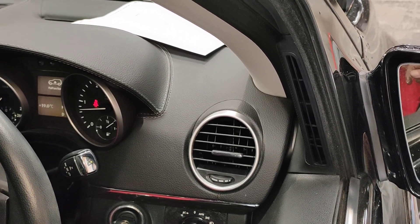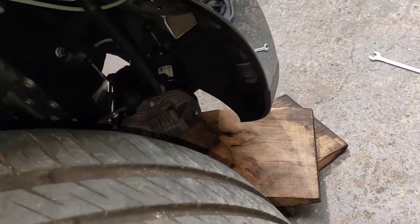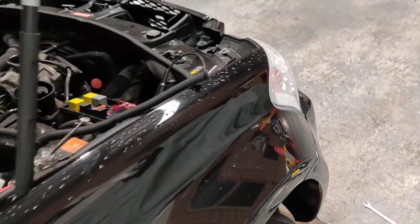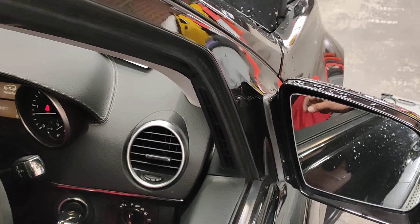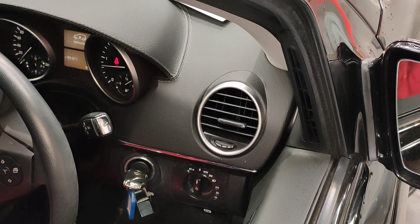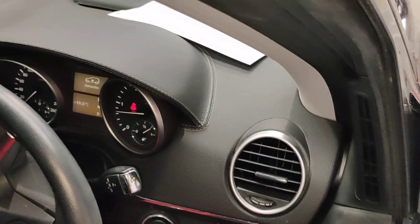The reason why the compressor was cutting out is because there's a short circuit with the actual pressure sensor, which is part of the air compressor. I've disconnected the pressure sensor side of the compressor, and now the car is running without cutting out. So I can confirm there is an internal short circuit with the compressor here, forcing the car to shut down.